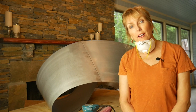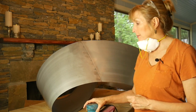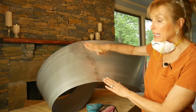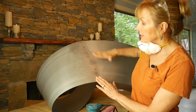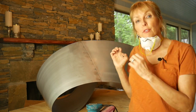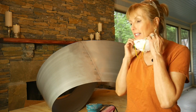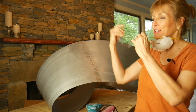We are on to the next phase. I have 60-grit sandpaper here that I'm going to use to sand this seam and get a pretty good wide spread of sanding, so that when I get to the Bondo phase there'll be something for the Bondo to really hold on to — nice grit, so to speak. Safety first — here we go.